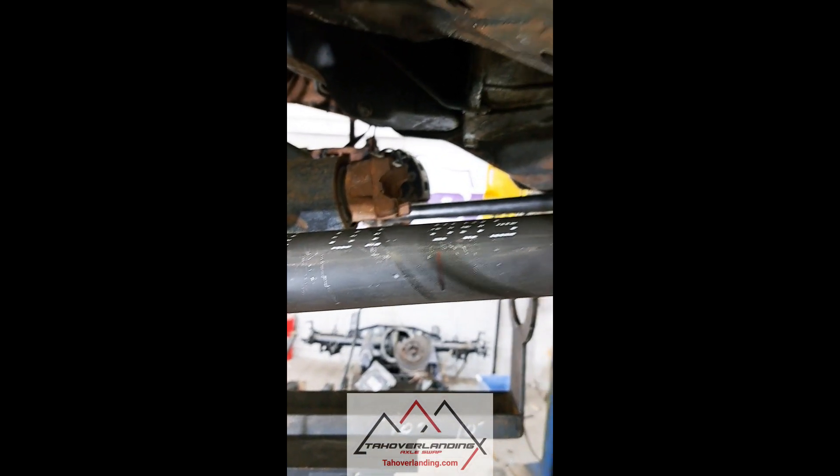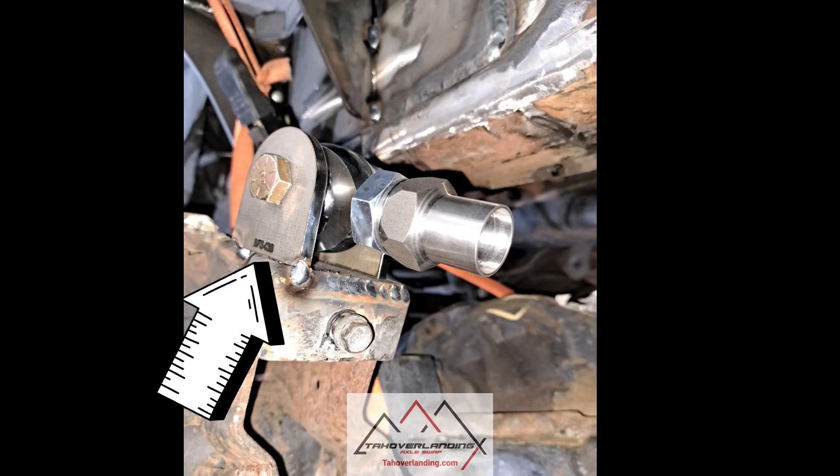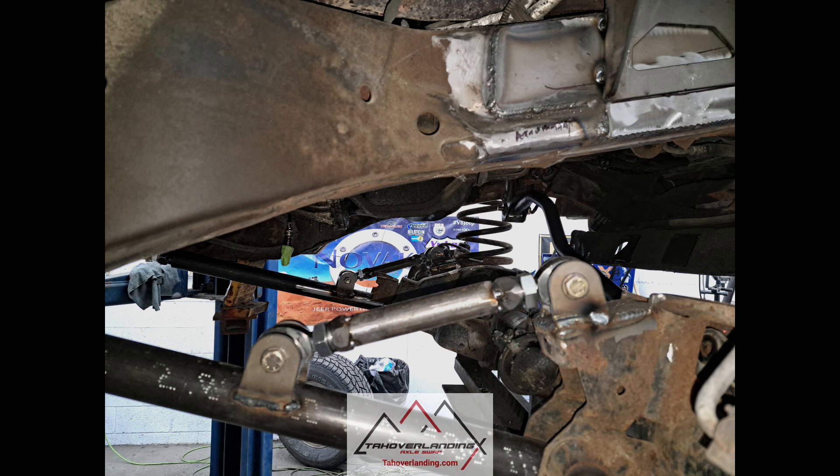When getting ready to make your upper locating arms, measure from the center of the lower control arm bolt at the axle and make a mark 12 inches back on it — that's going to be the center bolt for your upper locating arm tabs. Once you've welded the tabs on the radius arm side at 12 inches back, use that to line up the upper locating arm tabs on the axle side, get the joint in there, and weld those tabs on. Note that the tabs on the axle side will be twisted just ever so slightly inward so the joint is neutral. Then measure between the weld-in fittings to determine the length of tubing for your upper locating arms. Only tack weld it because you need to get the driveshaft in to confirm the U-joint working angle at the pinion is around zero to one and a half degrees before fully welding.